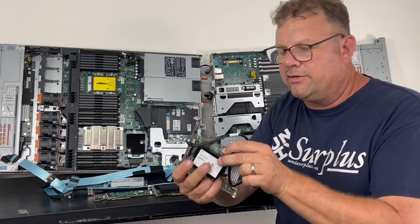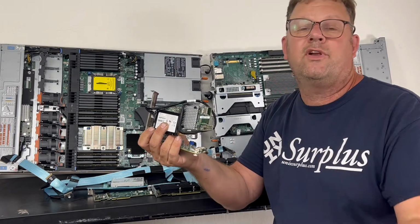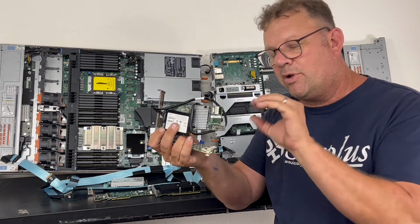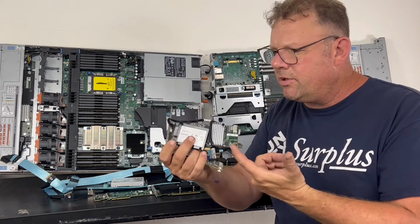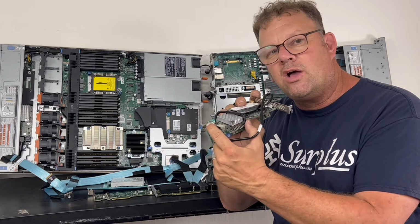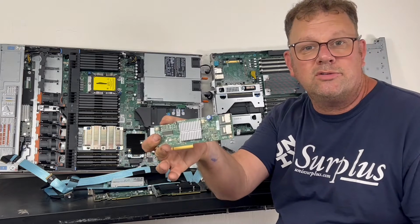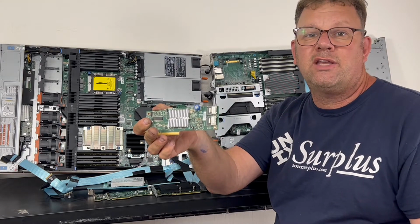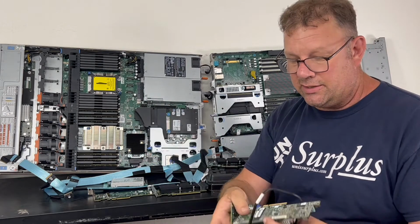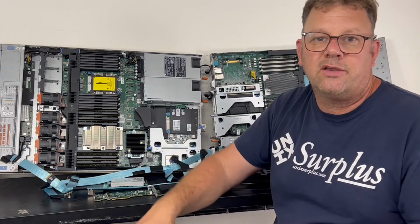Disk drives started out using SAS RAID controllers that took a lot of very slow spinning drives and aggregated them into one. You had all sorts of things like batteries, SAS controllers, even little dongles for RAID license. Sometimes they were pretty simple. JBOD modes like this one didn't really have any intelligence or memory cache like these controllers do with their memory chips. But it was all tricks to accelerate disk drives.